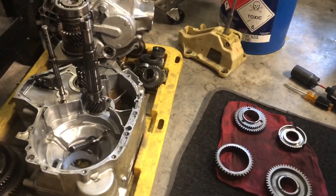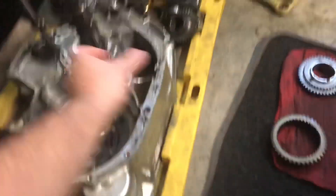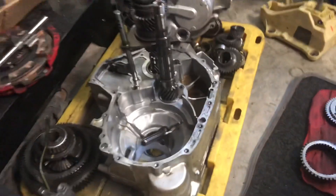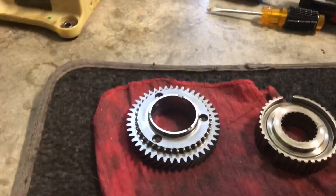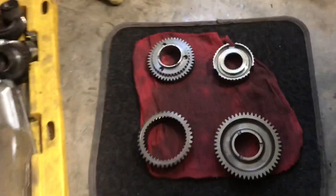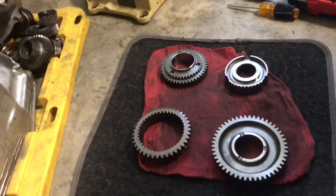Since this isn't too much of a tutorial, I actually did it off-camera. It was a little easier how I discovered to do it — I just used a little rubber mallet while holding the gears with my hand. I started with the top ones and would just tap it down so the gears started coming off the splines right there, starting with fifth and fourth, then working down into third, second, and first. Here we have what I believe is first gear and second gear, along with the hub and slider.